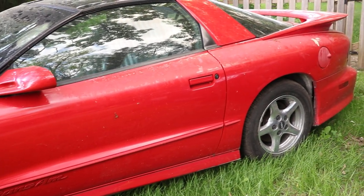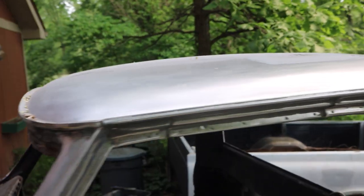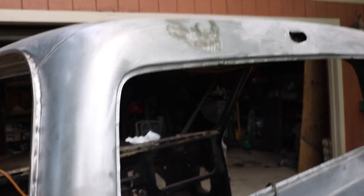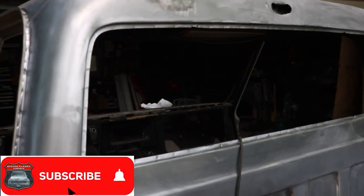One question you might be asking yourself is: do I always have to bring it down to bare metal? If it's on something newer, the clear coat's coming off, so we know the clear coat's bad, and there's actually some primer showing through. On that car I would not take it down to bare plastic. Now, on a 49-year-old car where you don't know what to expect underneath the paint, because it's already been repainted — somebody stripped this thing at one point and coated it with self-etching primer. Nothing wrong with that, but it's a product that needs to be top-coated fairly soon.